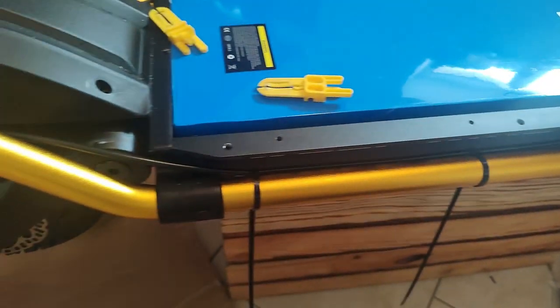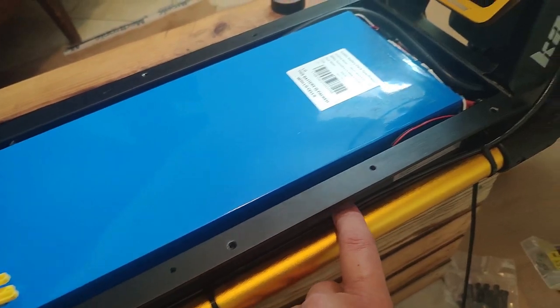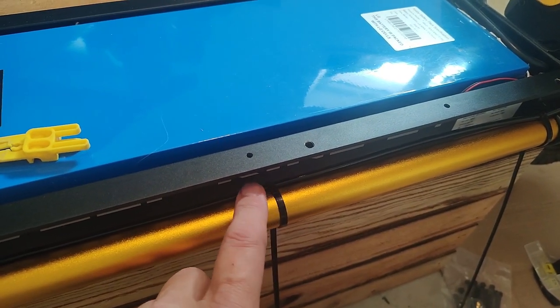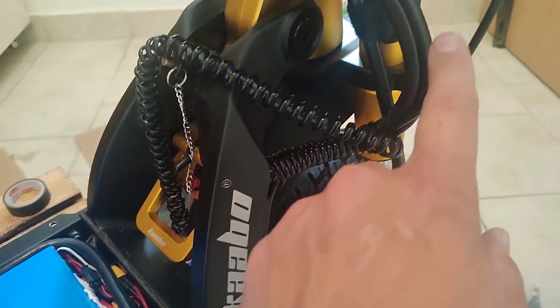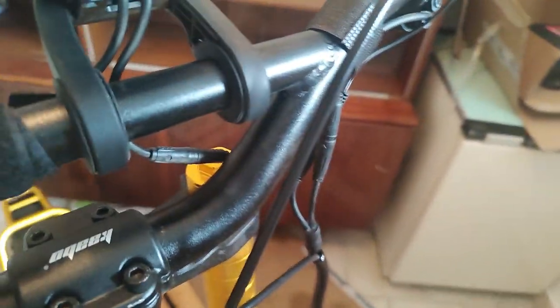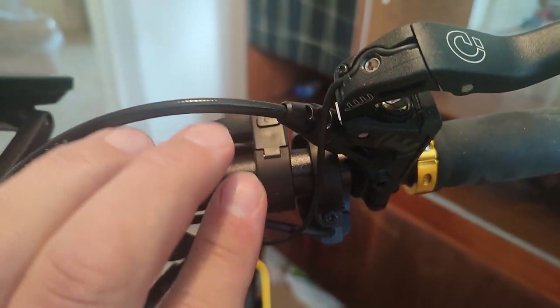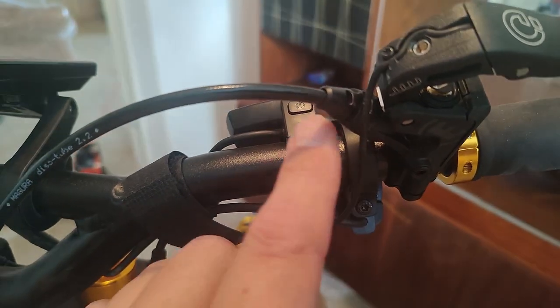To be honest, I don't think it looks that bad, and for me, by far, brake performance is the most important thing. After going through all this work and time and frustration and expense to do this brake upgrade, the last thing I wanted was to have my hydraulic cable going through with four or five tight 90 degree kinks in it. So this worked great, absolutely no problem. And obviously it's best for performance not to have any tight bends in that cable.